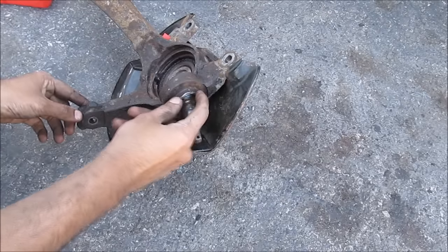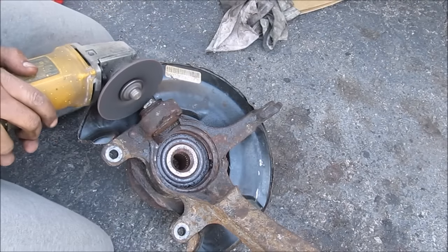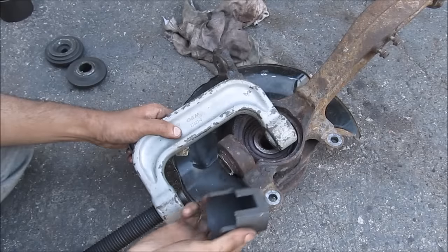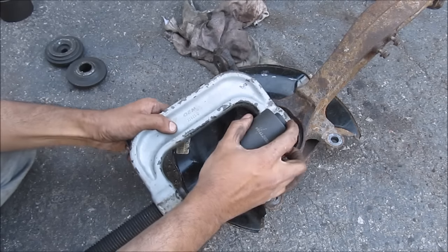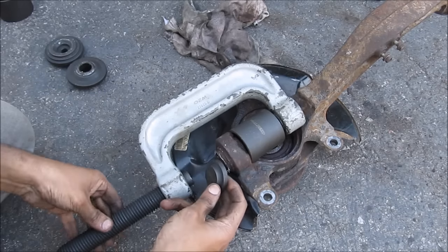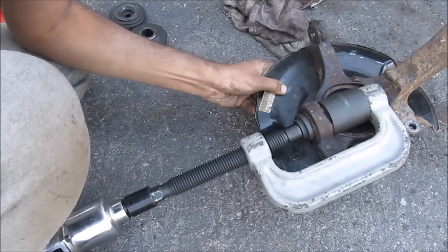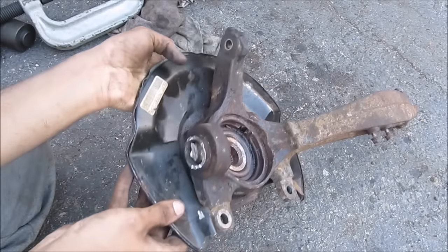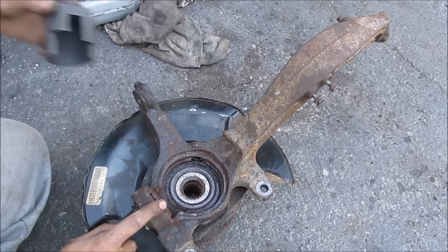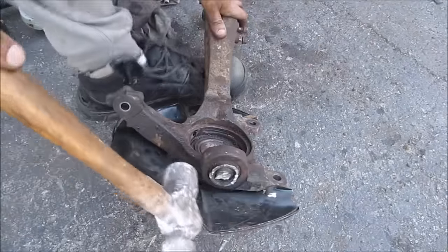You can really see how loose this ball joint is — there's so much play. Because my ball joint press does not have the right adapter to press out the ball joint, I'm going to have to chop off the ball stud. Here's my setup with the C-clamp: I've got an adapter that goes onto the steering knuckle, then my C-clamp that goes onto that, and in between the C-clamp screw I'm going to push the ball joint out using this adapter. The adapter is a little bit too small and catching on the ball joint instead of on the knuckle, so I'm just going to pound it out.